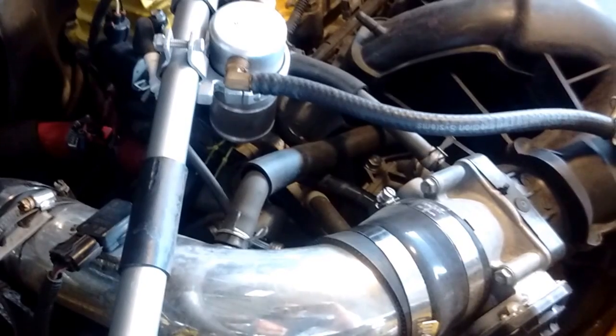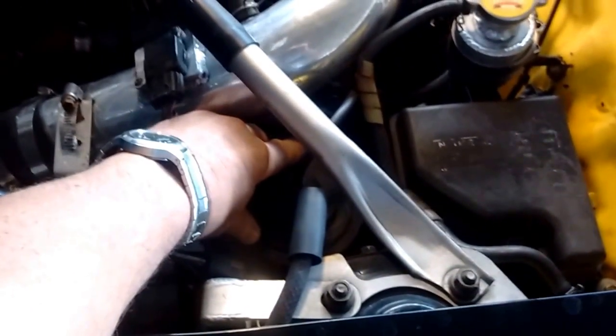The second thing to look at is the EVAP purge valve. With the MR2, we do a little adaptation of the EVAP system. I have the stock EVAP canister right here — it's capturing fumes from the gas tank. There's a hose that comes off the top of the EVAP canister and goes to the EVAP VSV — vacuum switching valve — which is plugged into the harness and controlled by the ECU.